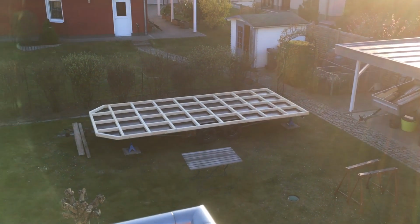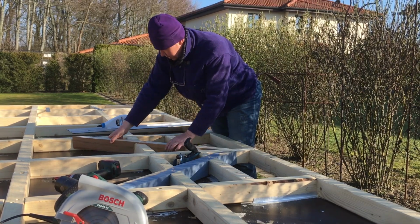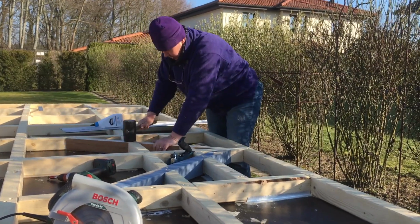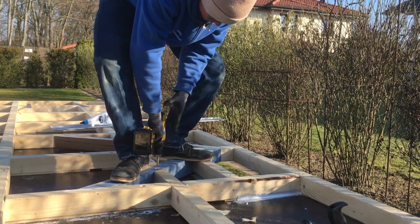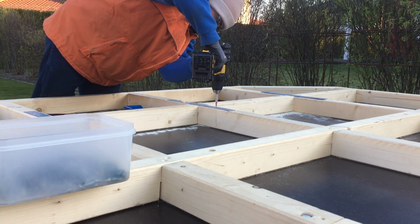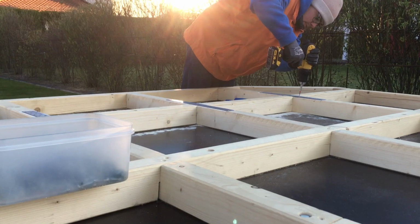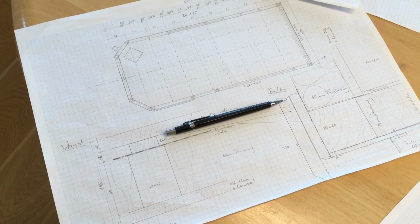After the grid was completed, it was bolted to the trailer. Where the grid hung freely over the wheels, we felt the need to add some additional support. Same thing applies to the front, which was also hanging freely. Here some thin steel bands were added flush to the grid, which improved the rigidity greatly.